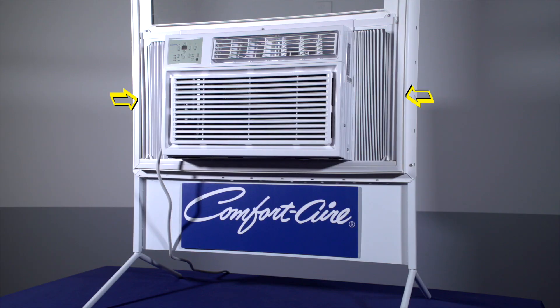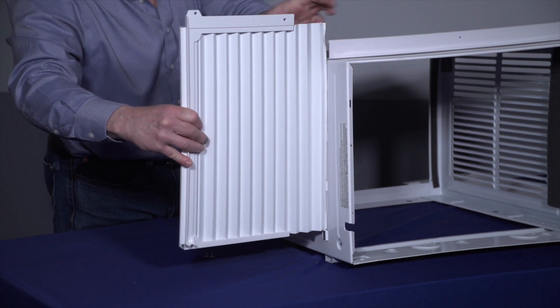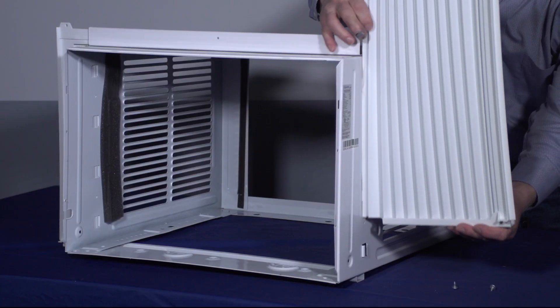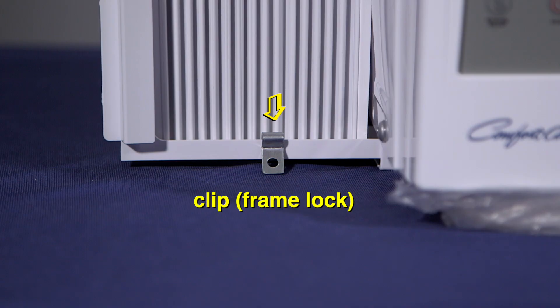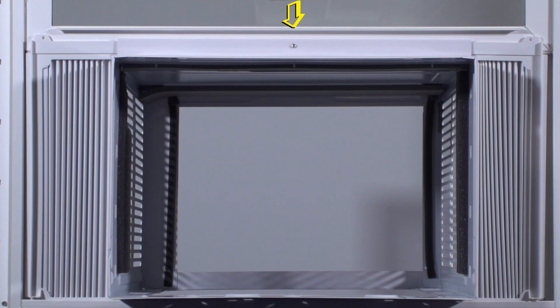The accordion window seals fill the space on each side for a snug fit and seal out the elements. Expand the accordion seal and slide it down the side to engage the exposed clips. Push and let the accordion compress as far as it will go, then repeat on the opposite side. Later, you will use either two or four screw locations, depending on your model, to secure the accordion in place. For some models, clips may also be used. The screw point at the top center is for screwing the mounting bracket into the windowsill. This mounting bracket will fit on the top of the lower pane to lock the window in place.